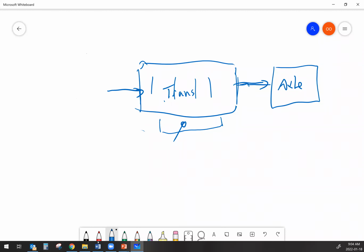So when it comes to a power shift, is shift modulation still a possibility? Yes and no. You can control how crisp or how soft the shifts are going to be based on things like an orifice size that the oil can flow through to get to the clutches, right? You can have what are effectively little accumulators that allow that pressure to build a little bit more gradually.